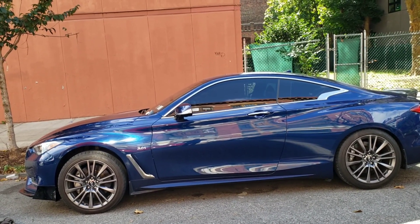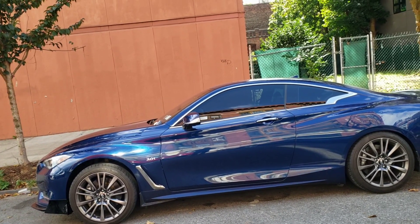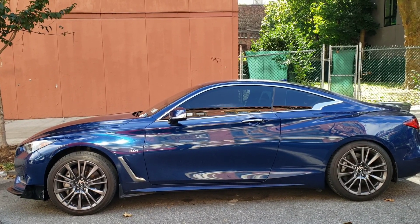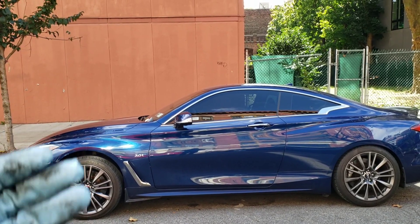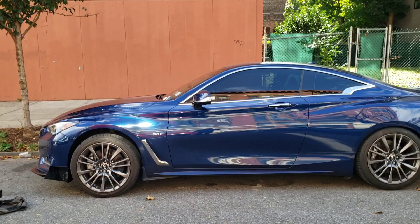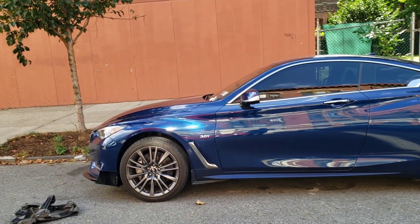I forgot — a novice mistake. If you go with a softer spring rate, it slams the car. I never changed the geometry of the coilover, just went with a softer spring and it was slammed on the floor. So I moved the coilover taller. Now I put in a stiffer spring and look how it looks. In this video I'm going to show you guys how to adjust the height of your coilover. Let's jump into it.